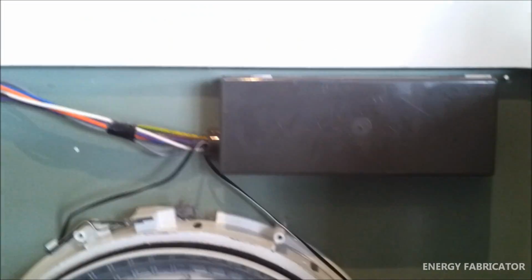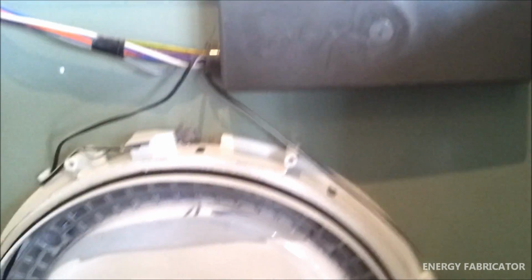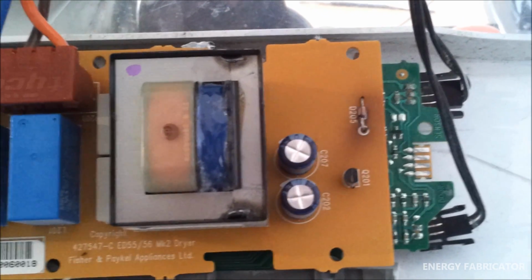You never really hear much about the electronics in the front panel getting damaged in any way, but having said that, I'll just show you a quick repair that I had to do last time when I took it apart. You can see on the top circuit board there that there's a little diode, and all around it it's all scorched on the circuit board. Now that was there last time when I took it apart, so I took the opportunity to replace that diode with a diode rated to a higher voltage, and it seems to be working fine. It doesn't look like that scorch mark has gotten any worse, so I think it fixed that problem as well. But apart from that, there's not much more to these things.